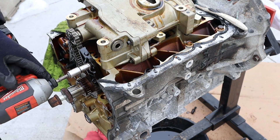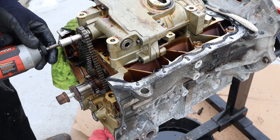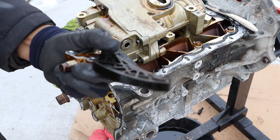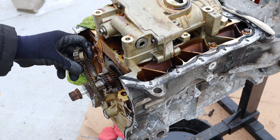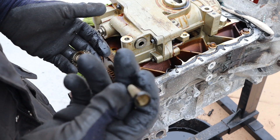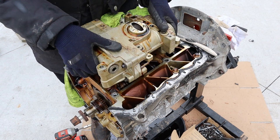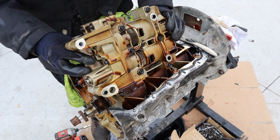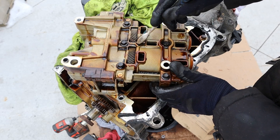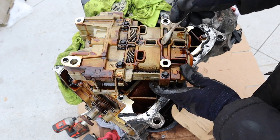Pulling off a couple of tens — once again we've got plastic guides. Pull off this ten for the oil pump. This is also a hydraulic tensioner just like the timing chain going to the cam, and we've got another plastic guide over here. I can pull off that oil pump and the little chain. This thing that fell out is actually an oil filter to catch oil debris — and you can see it's actually pretty dirty with a lot of grime. We can pull off the oil pump and balancer assembly. Here's the balance shaft assembly — you can see there's a lot of sludge inside of here. This motor is just high mileage and really tired.